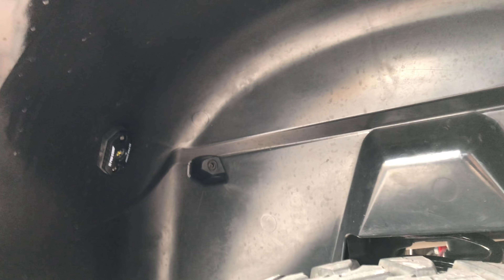Now for wiring — the ground, I'm grounding it to the nearest point on the chassis. You can ground it to anywhere on your chassis. The front two are grounded there for now. And for power, all of them just go to aux number one, which is connected to my aux panel I got from Fourth Gen RAM Electronics. With the key out, this is awesome — if I want my truck sitting and UFOing, all I gotta do is hit the button.